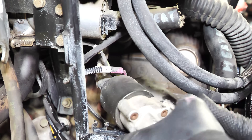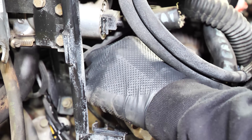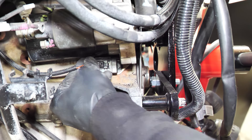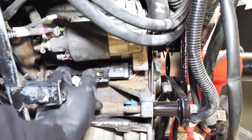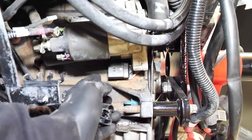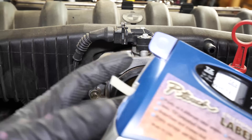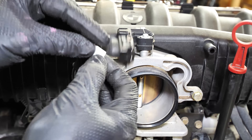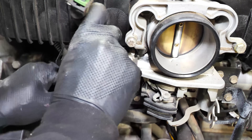It's 10 millimeter on the little pink side of the starter motor, 8 millimeter on the other. Instead of marking it G for green, it might be better to mark it toward the side of the nut size — I think that would work better. We've got a little connector with a brown, black, and white wire — that's the crankshaft position sensor, CPS. Zip-tied back on, routes to the back of the engine.